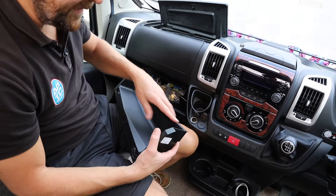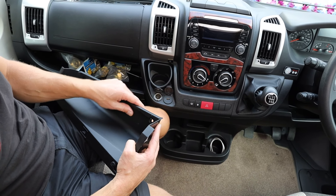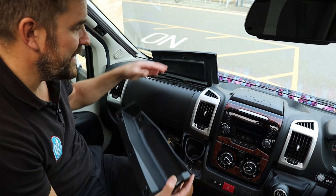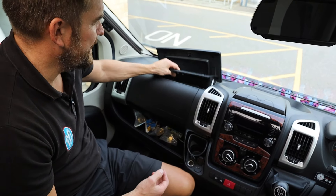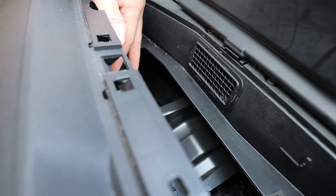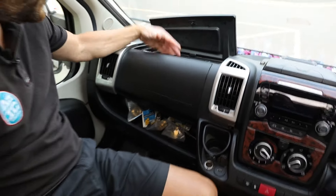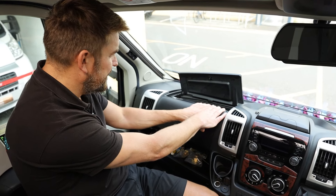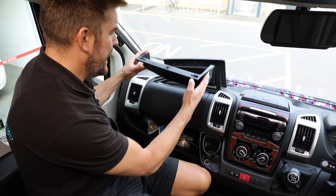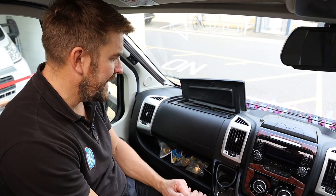The reason we remove these is because we'll get a nice round file, take a nick out of the corner or the side here, and allow for the USB cable from the new head unit to go in nice and neatly so it's not trapped - allowing your phone to plug in facing upward. Also, inside this cavity you've got access to the chassis and can cable-tie any extra slack. That is what we call the top glove box - really simple. T20 Torx screws, panel just lifts out and to pop it back in you just put it back and push down.